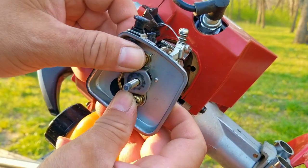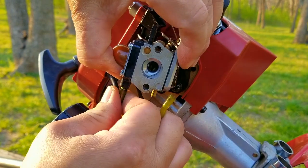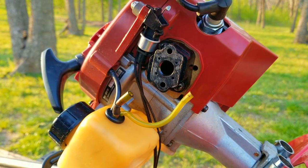More than likely, the leak was coming from it, so I'm guessing the metering diaphragm is not only petrified but pushing on the rocker arm for the needle. This wouldn't shut off the fuel flow through the carburetor and allow the fuel to leak out of it.